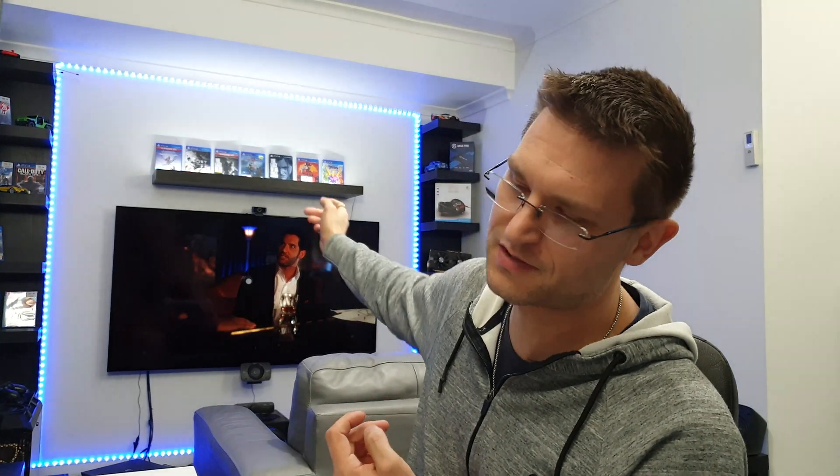We start today with Dolby Vision. I've spent a lot of time on research figuring out how this works. The meter is still on the TV because I'm still testing — the next project is HDR movie calibration and I want to do it properly this time. Today I just did a two-point calibration on Dolby Vision, because a two-point calibration is really done in a couple of minutes.